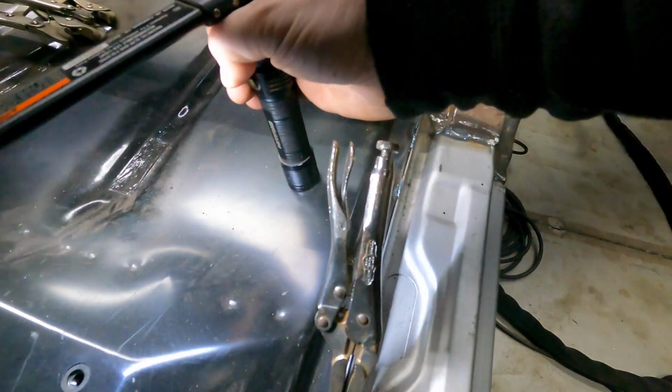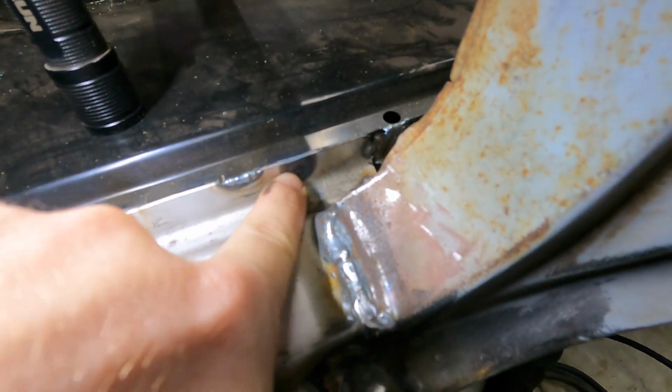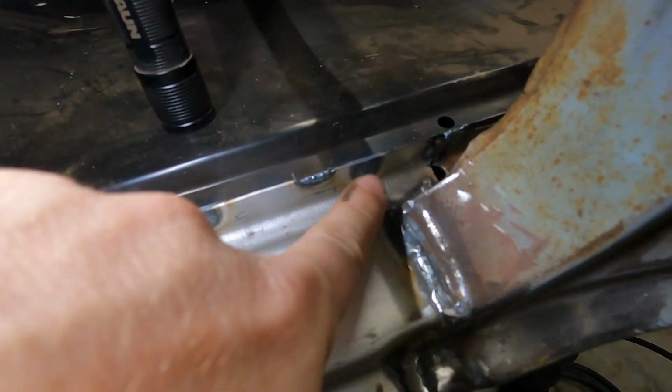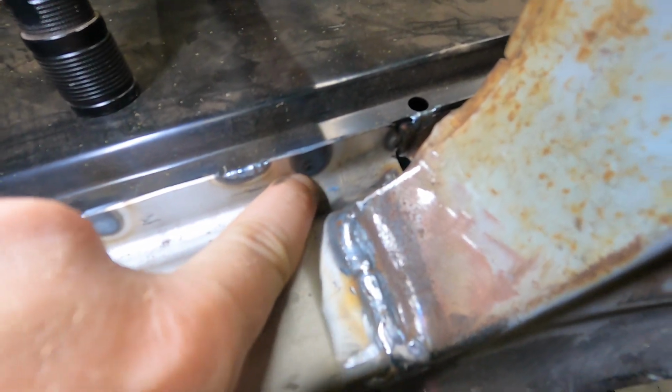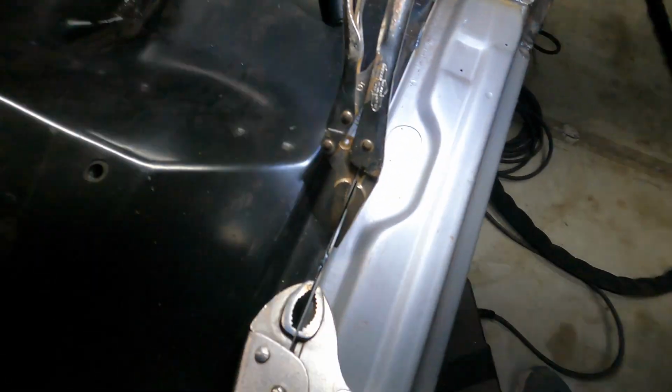So then, I'll try and show what the profile looks like here. So these start off with that big hump, but when I really ramped up the weld, it got quite flat right here. So it sucks all that weld metal in and bonds in with this side. So that's what I've been doing, just kind of burn it in, and you can see it's melted on this side. You've got a really strong bond, basically close to the diameter of the heat affected zone there. It really ties in.